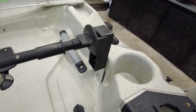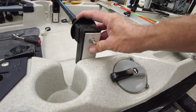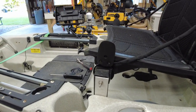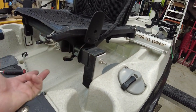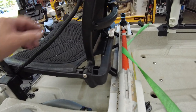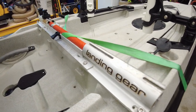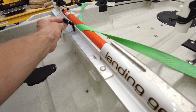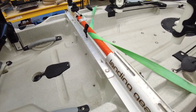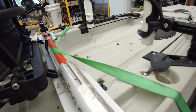There you go — we've basically just installed two aluminum brackets that we made ourselves. Very simple: all you need is a drill bit and a hacksaw, and we've located this bracket up almost double the height it can be from the factory. It's literally four full inches higher roughly than from the factory — we basically just moved the blocks up the height of themselves. Huge difference in comfort. Now back here, this is where it got a little tricky in my situation — I have the landing gear. What I did is I added a little piece of angle iron across here and relocated the lock tab for the seat on that, bolting it to my landing gear.